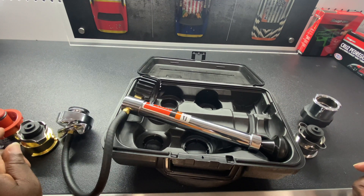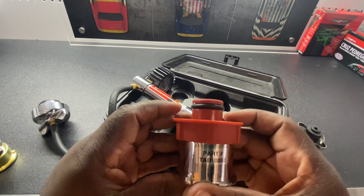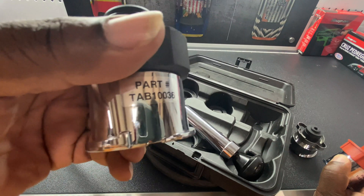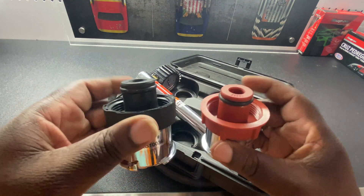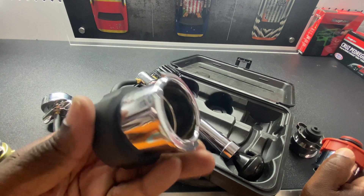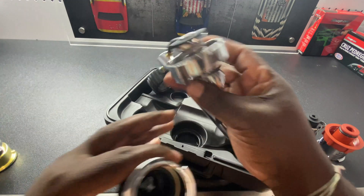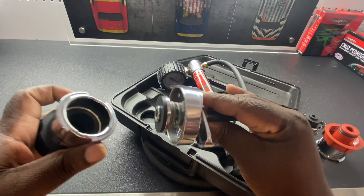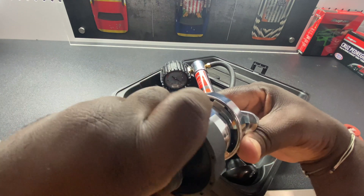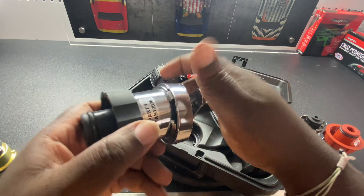I went to connect these to the expansion tank on the Volvo, but unfortunately none of the adapters I have fit it — the Volvo has a smaller opening. Each adapter has a part number on it, so you could order the correct one from Snap-on, or find another company that makes them a bit cheaper. To connect to the radiator, you push it in and pull it down to where it locks into the cam teeth stops, locking it in place.